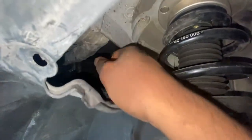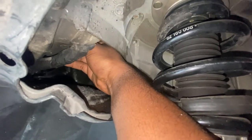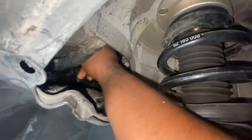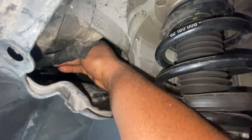With this piece out of the way, you now have access to get your hands underneath to the hood release latch. Put your hand back here and feel for the hood release, pull it off the engine bay, and you're going to feel two wires.